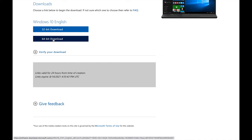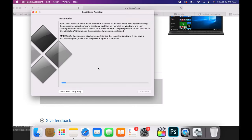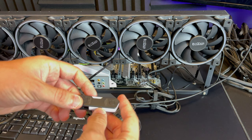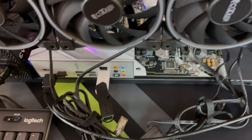If you're on a Mac, press command space, type in boot camp assist, hit continue, and uncheck 'install Windows 10 or later version', then click continue. It will start downloading. When it's done, take the USB drive and plug it into the rig, then turn on the rig.